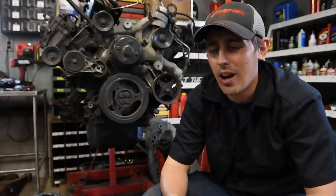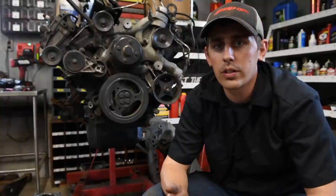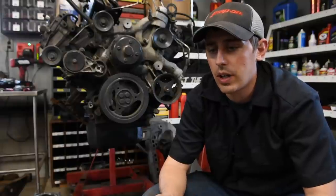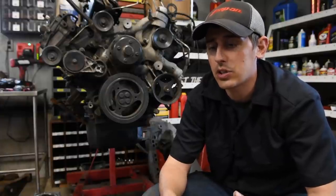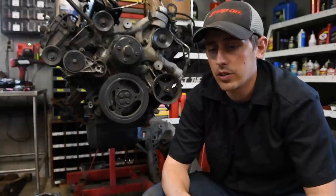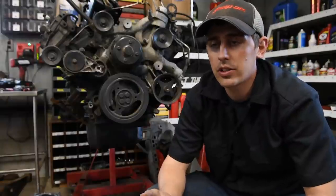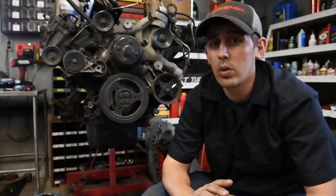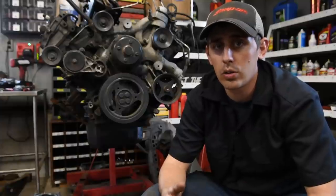Additionally, according to IPR, the tests they've done have shown that the liquid to oil cooling really shines during a towing situation. In these situations, you have typically reduced travel speeds with elevated engine oil temperatures. You're putting a large load on the vehicle and you're seeing less airflow across the radiator. The radiators in these trucks are really efficient. The fans are really efficient. But if you use an air to oil cooler, you're really depending on the incoming airflow to keep that cooler cool.